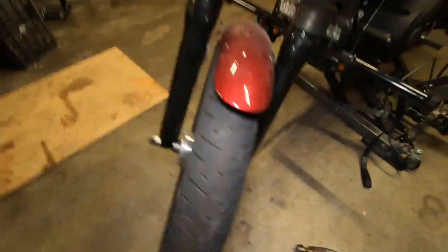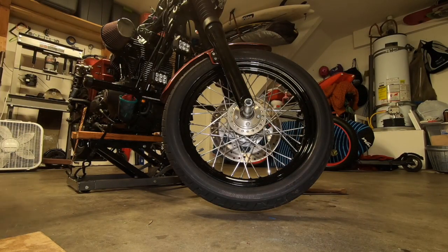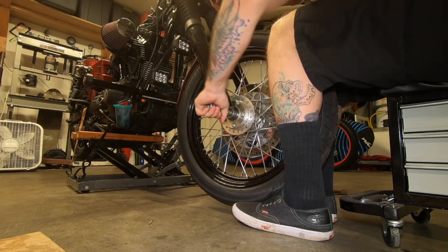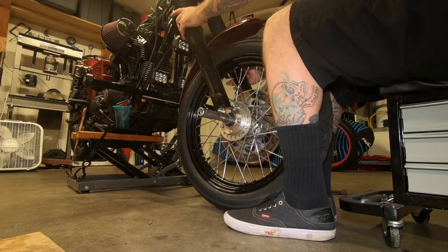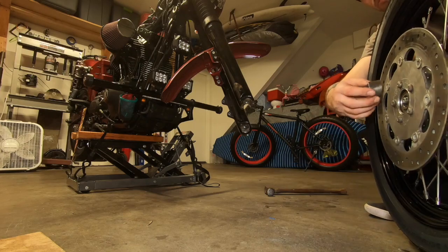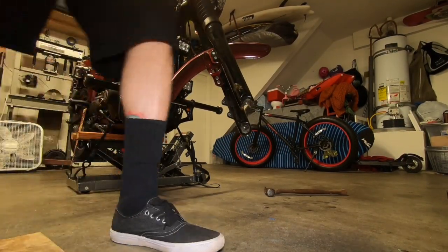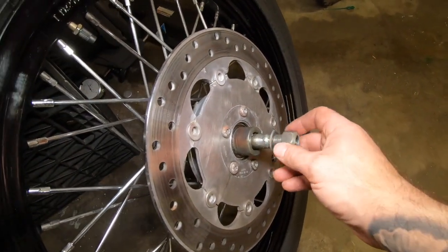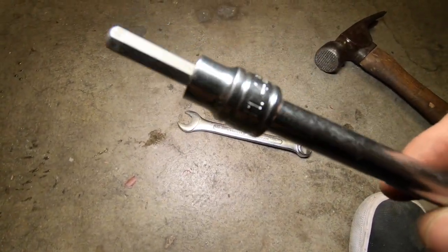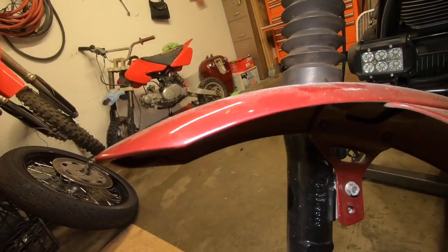I'm tapping the bolt through just to show the people who haven't worked on their bike before how easy this can be. But when you are working on suspension, you don't want to be a newbie. Without good suspension, you'd be hitting concrete — so you better be thorough or your life will be in jeopardy. If you ever see oil spots underneath your forks when you're done, you need to remove it, tighten the bolts on the bottom, put silicone — whatever you have to do. Never have half-ass shocks.